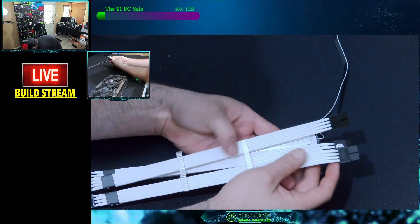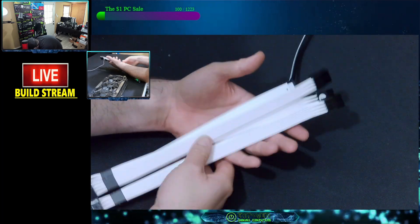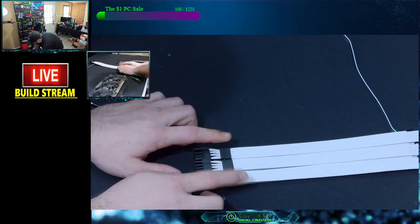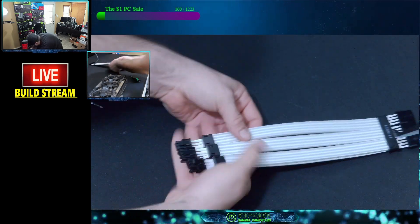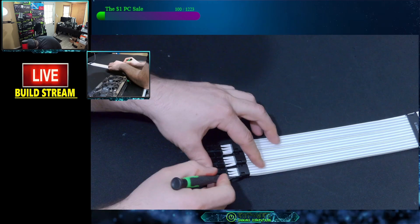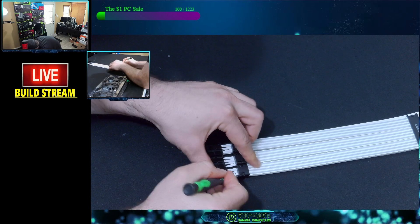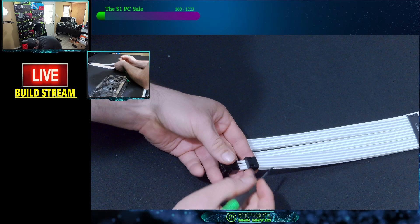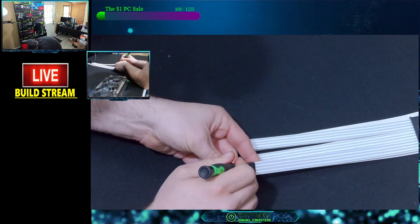Completely free from the cables. Next, we can take these clips off — pretty easy to do once you remove those. The last step is we have to remove the clips from each of these cables, which are three separate clips on this one with the PCIe times three. This is the V2. To do that, you'll flip it around so that the RGB is facing up, and you just push this clip in and push it down. You have to do that on both sides like you did on the other end.